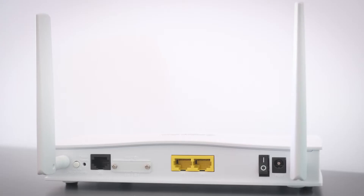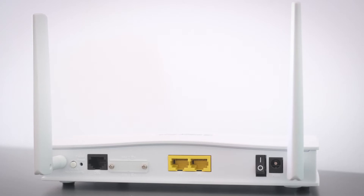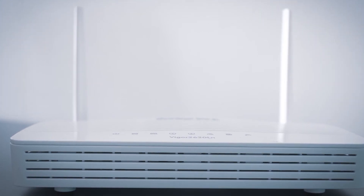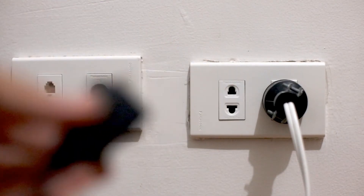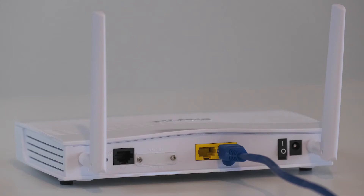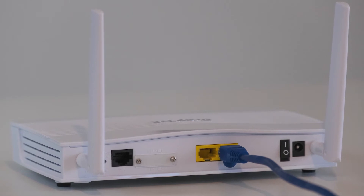The next method is to push the reset button on your modem or your router. Not all routers have this, but if yours does, give it a try. If that doesn't work, find your router that is giving you Wi-Fi and unplug the power to that for 60 seconds, then plug it back in. This is different from pushing the reset button on your router, so make sure you do this.